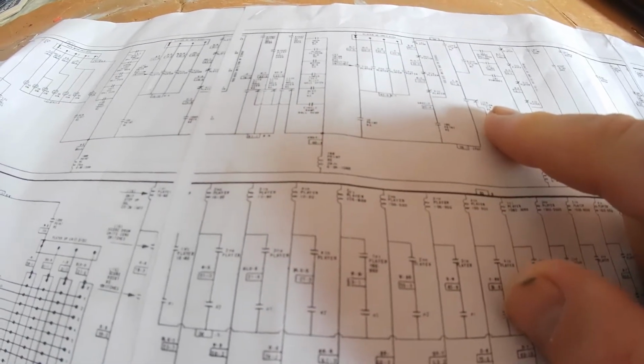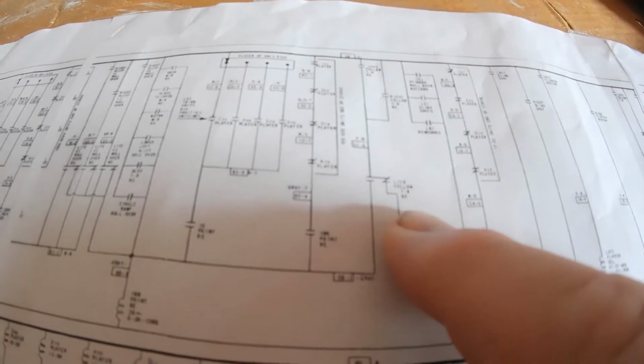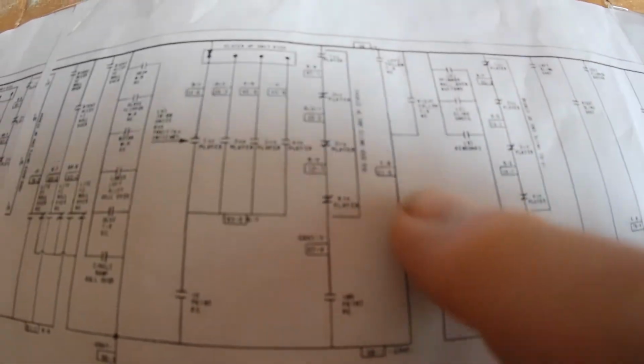And now the other end of the 10-point relay goes to a set of contacts, and that says, I know you can't read it, light yellow thump and bumper relay. So I found that on the bottom of the play field, and that too is a white wire with a blue trace. I found that set of contacts on that relay, put a piece of cardboard in there, and that relay was still being energized. So that told me this couldn't be the problem, or I should say most likely not the problem.